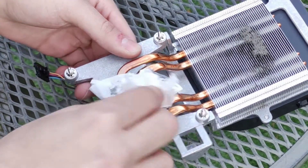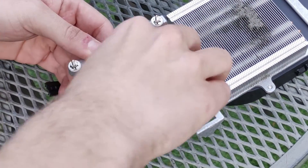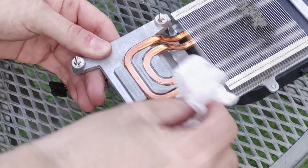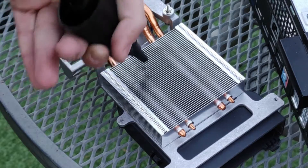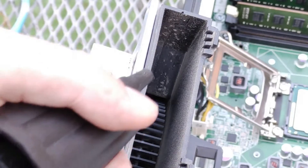However, it may be challenging to remove thermal paste from the gap between the heat pipes and the aluminium block. You can scrape the stuck paste out with your thumbnail or with a toothbrush pressed into a tissue. You can then blast the dust out of the heatsink using whatever preferred method of dust blowing you have, and blow dust out of the exhaust of the fan similarly.